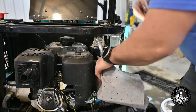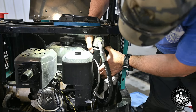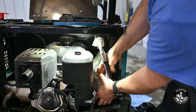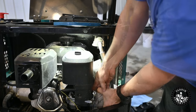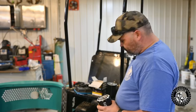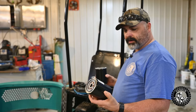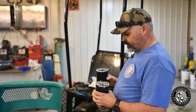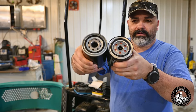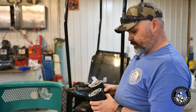Let's put a soaker pad down in here. It's a good thing I put a soaker pad in there, it's a bit messy. On close inspection, the Chinese filter has zero numbers on it — nothing. I thought the Napa 1515 looked like the right filter, the O-ring's the right size, but the threads are not. You can see it's quite a bit bigger on the Chinese filter. So I'm going to have to go to town, let this drain, take this Chinese filter with me and see if I can match it up with the right filter.